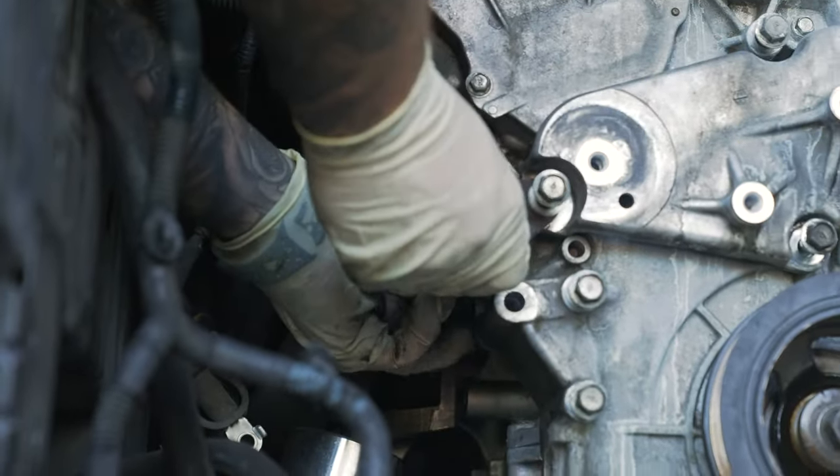That keyway — if you look at it head on it looks like it's not right, but that's just how Nissan did it. The Woodruff key is right here in the center of those two teeth. Just make sure the tooth to the left of the keyway is lined up there. When I do it I just make sure the Woodruff key is kind of right, like a tooth over. Now we can take the tensioner off, the guide off, pull this chain off, and get the gaskets out.